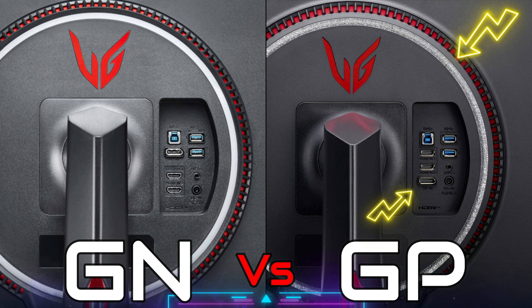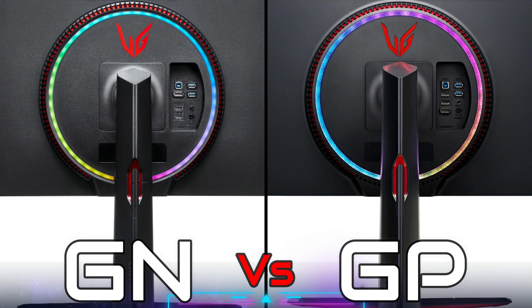If you're looking for that 4K 120Hz through HDMI 2.1 on the GP version, the main things to look out for are the display port on the bottom and the foil-looking backlight cover — you can't go wrong. As long as it's the foil system, you know you have the GP version. Here's how it looks with the LED lights on: the foil is still pronounced and you can easily see it with or without light.